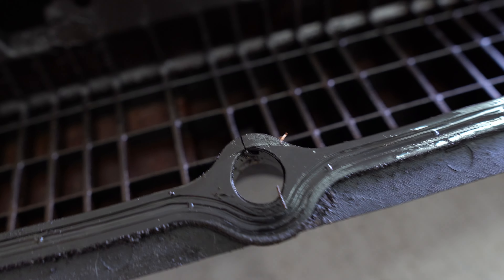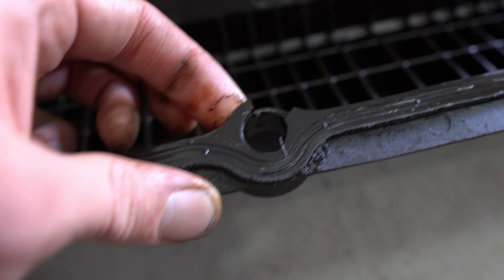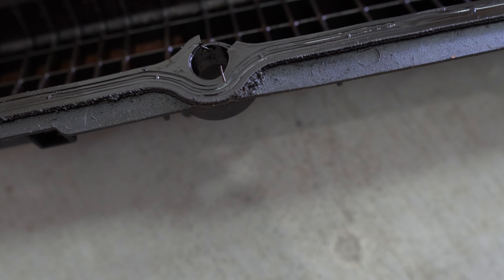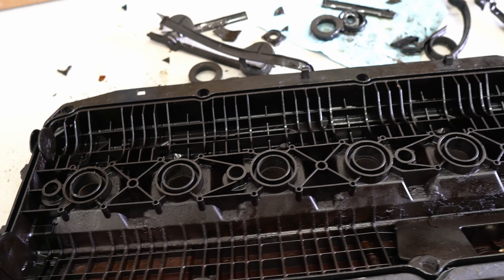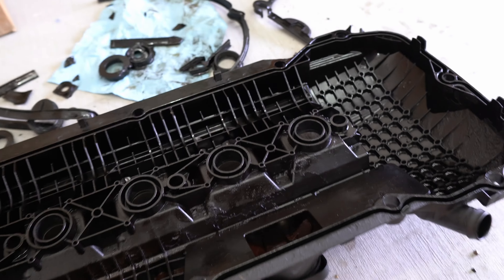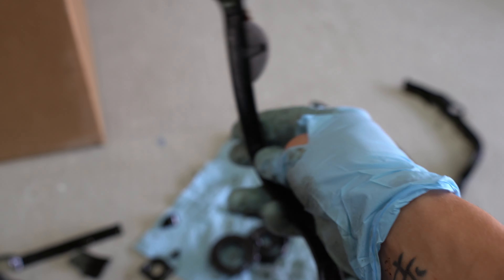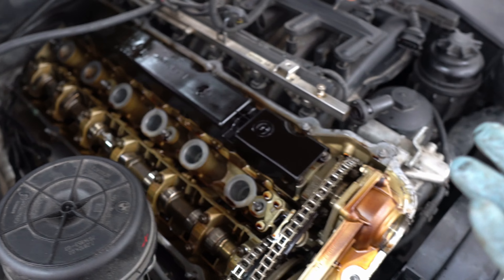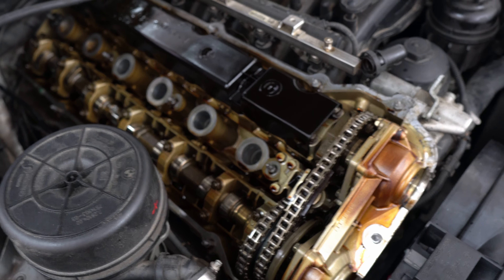Look at this thing — this is supposed to be rubber, but look at that, it just snapped. This rubber has gotten so old I literally just cut my finger. Sorry, I had to go get a band-aid. But that just goes to show you how extremely hard this gasket is — it literally just cut me. It's supposed to be very flexible rubber like this, but this one is not flexible at all; it feels like plastic at this point. There's no doubt in my mind that this is the cause of the oil smell in the cabin. I think it's safe to say that gasket has never been replaced — it broke into a whole bunch of little pieces, cracking apart. At one point in time that was rubber, and now it's completely brittle. Even if the previous owner got oil changes, it was probably losing a lot of oil because of this gasket.